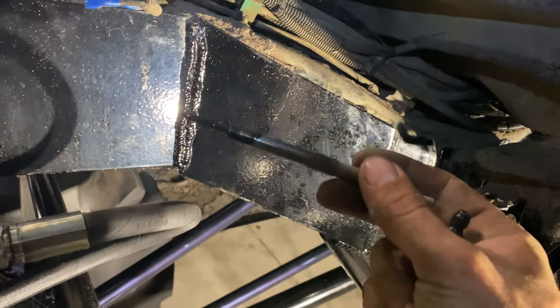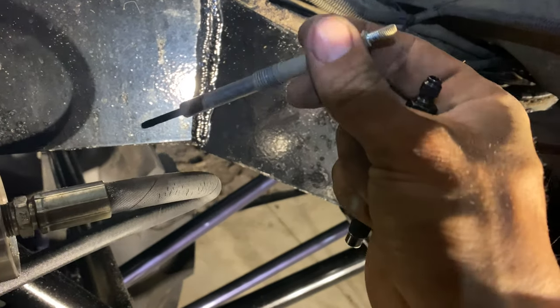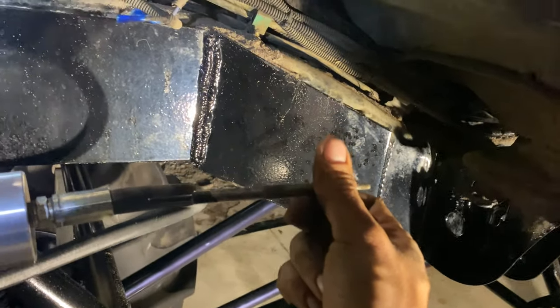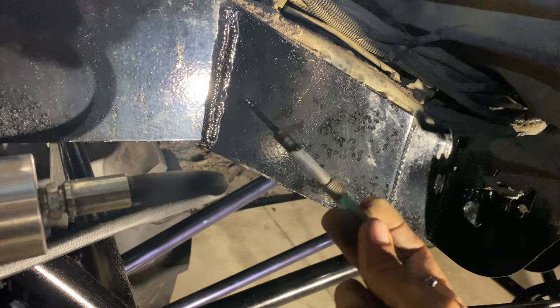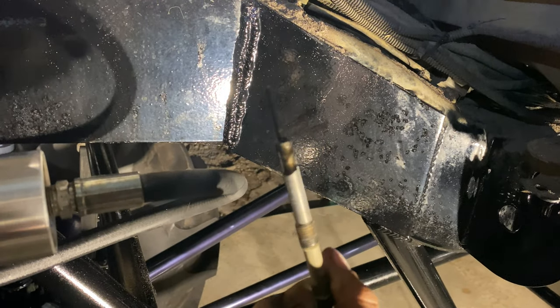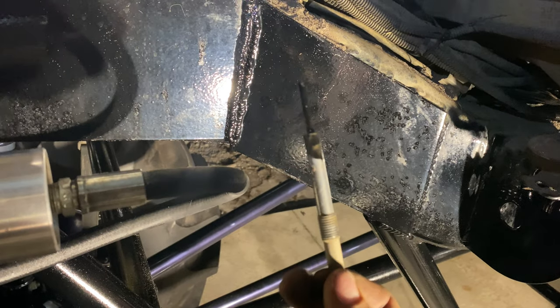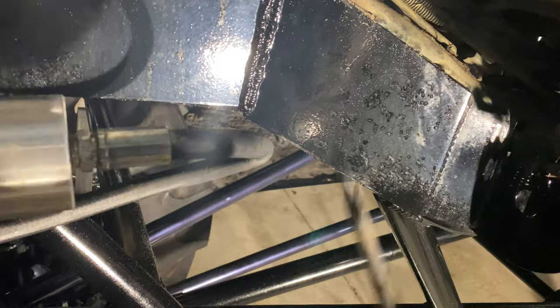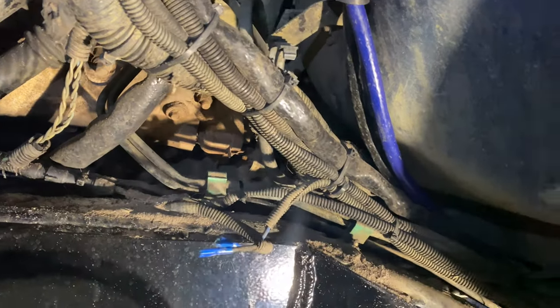This is not a good sign - just pulled this glow plug out of what I think is cylinder number eight, the back driver's side one, and there is much more oil on this than there has been on any of the other ones. The other ones were more kind of charred - this one's got oil all over it. I believe that might be the blown cylinder - I'm gonna find out here in a minute.